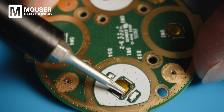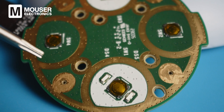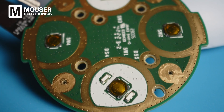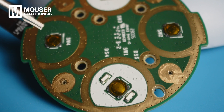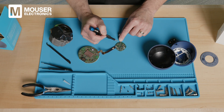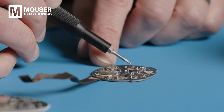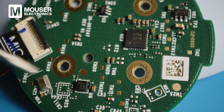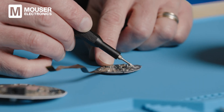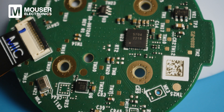I can feel a little bit of a membrane there. The other thing you can see on the back are four rings — these are holes through the PCB allowing noise to get to the microphones. There are four locations for microphones on this device, but only three are actually populated. There's one here, another one, and another one — and then they've got an unpopulated spot for a fourth microphone. I don't know if they use this board for another product or originally designed it in case they needed four for better performance.